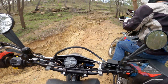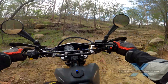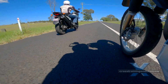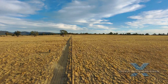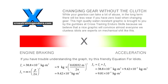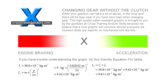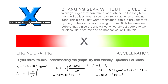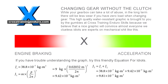So how do you avoid wear or potential damage? The key is no load on the gearbox when changing gear. When you shift to a higher gear, you back off the throttle temporarily, and there is a split second where there is zero load on the gearbox and a clutchless gear change is effortless. When changing down a gear, the key is to apply just enough throttle to remove any engine braking — again, zero load on the gearbox.